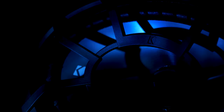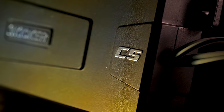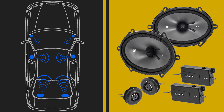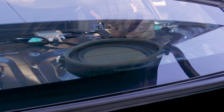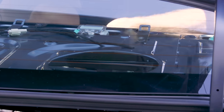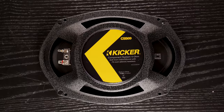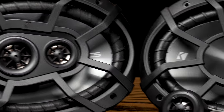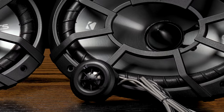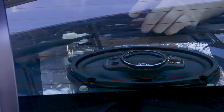Components usually come with a pair of speakers, tweeters, and most have external crossovers. A component set takes care of the mid-bass, mids, and highs, replacing factory speakers. This system is specifically ideal for Ford and Toyota guys with 6x9 woofers, which drop right into your factory location. The difference between speakers in a component set and coaxial speakers is that you have individual drivers that can be mounted in optimum locations and likely more on-axis.